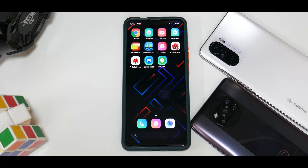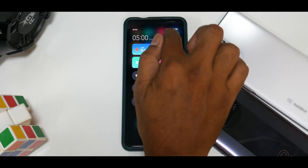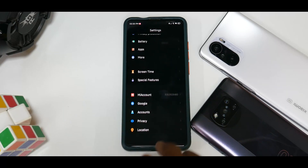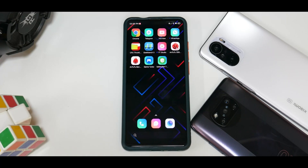Till then you need to take care of a few things: make sure you have an unlocked bootloader. With the K20 Pro, even if you have an unlocked bootloader, install the latest Orange Fox recovery from the description below. You also need to make sure you have backed up everything on your phone's internal memory, because you will be losing all your pictures, music, and videos from internal storage. Make sure your phone has more than 50% battery before you flash. And lastly, remove your screen lock, face lock, pattern, PIN — all security — as well as your MI account and all Google accounts from the device, to avoid any encryption or decryption issues.